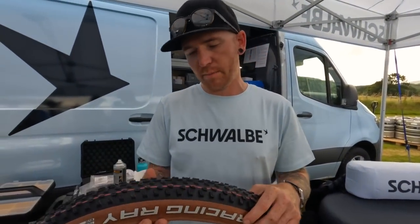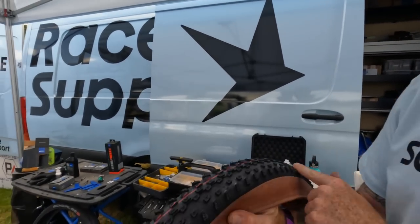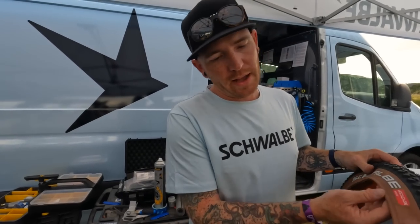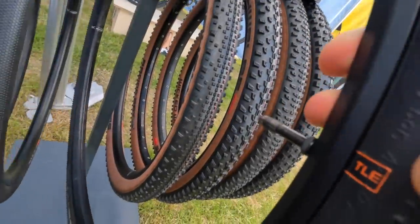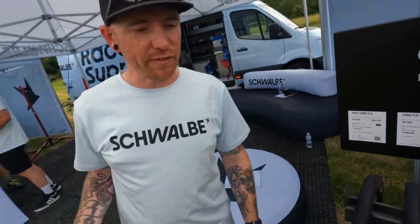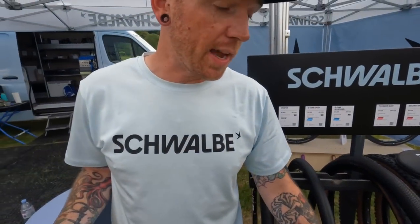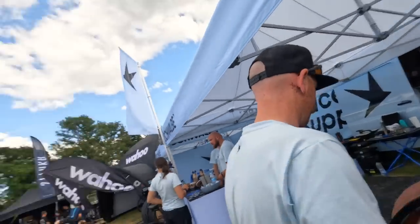The Reserve valves are called Fillmore valves - pushing up is how you get air in, then screwing on the end bit seals them. Any valve works with the same process. The special tyres have white logos - a bit of a throwback to older tyre graphics. Check the tyre direction with the rotation marker. People get divided on logo alignment - many line the valve with the pressure settings. Personally the middle of the Schwalbe logo is the preference, or align the tubeless easy tab - the TLE flag - with the valve as all other logos are symmetrical.